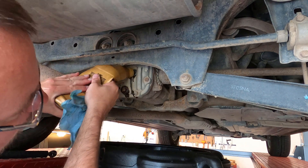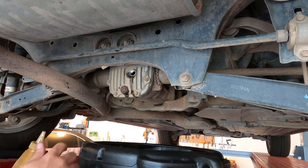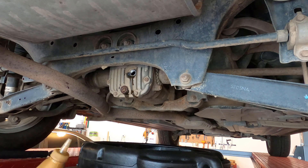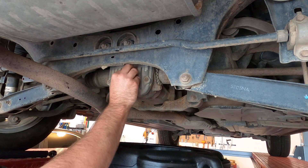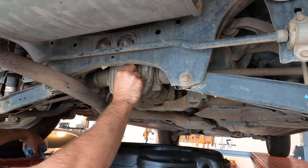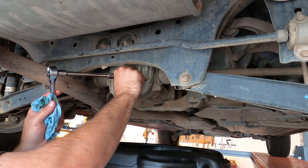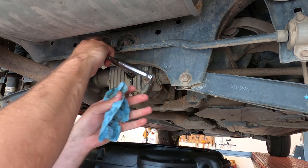You know you're done filling when the fluid starts running out of the top fill hole — you'll see it dripping out. That's the correct fluid level, right at the bottom of that hole. You can feel inside to confirm there's fluid there. The final step is to install the fill plug and tighten it to spec.